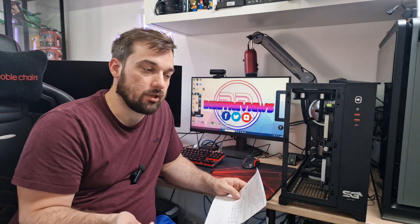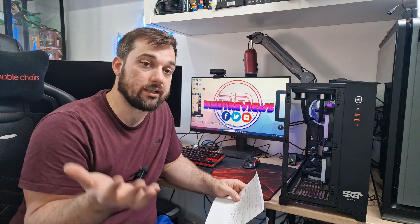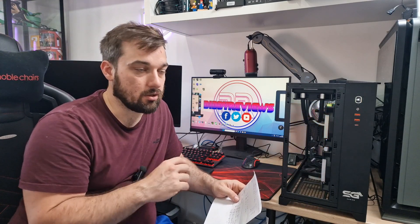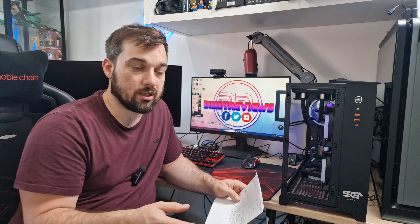Let's talk about performance — Thermalright are smashing it out of the park again. The test system is a Ryzen 5900X on an Asus B550E Strix motherboard with a 3080 and 32 gigabytes of RAM at 3600. The CPU is stock with PBO turned on to auto. I run a five-minute Cinebench test to see the maximum temperature at full speed. I'll also be doing a series later with noise normalisation figures so you can see how coolers compare at the same noise level.